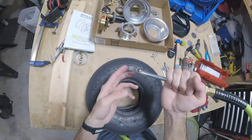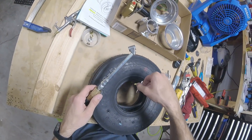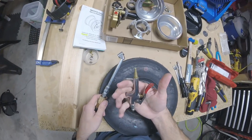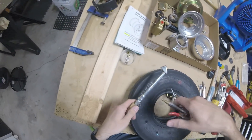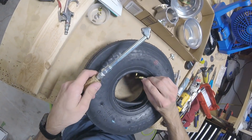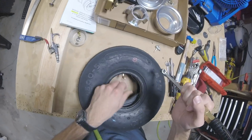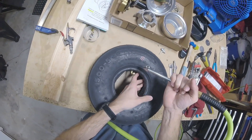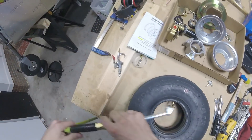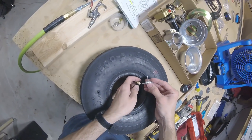The air tool's little plunger can't depress inward to let air flow into the inner tube. So I'm going to back the valve core out a little bit — you might have to take it all the way off and use an air blower to just blow air in. I'm backing it off a little so the valve stem stays in but protrudes a bit more than normal, and then I'll just put a little bit of air in here. It's leaking out because it's not tight, but that's okay — we've got a little air. I don't want too much.